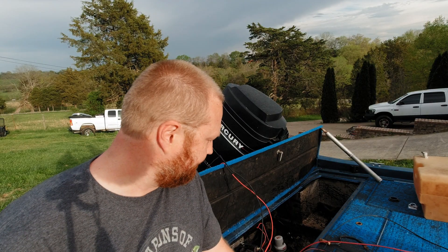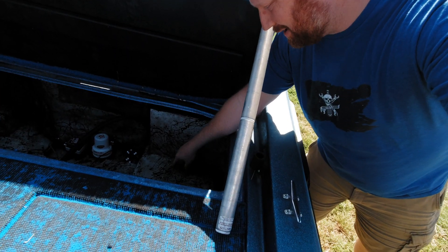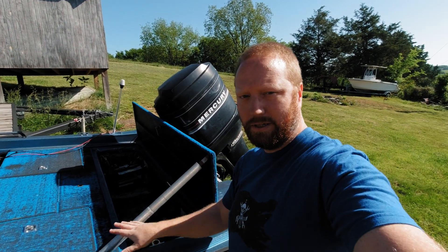The pump is spinning but no water is moving. Eureka — I have a discovery: the bilge pump and the aerator are wired to the wrong switches. The bilge pump switch flips on the aerator, and the aerator switch flips on the bilge pump. So the aerator was running completely dry. I flipped the true bilge pump on with the aerator switch — the bilge pump works, except the hose is busted so nothing goes overboard. I've got to get some fiberglass knocked out and get this stuff fixed so I can start putting this thing back together.